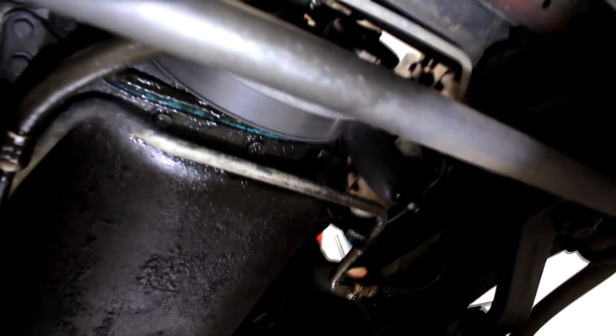Okay, so let's go underneath this thing, get my flashlight on here. Now look at how wet this is, guys. This is all soaked down here. It's definitely leaking some engine oil from under the crank seal. I can see it if I look behind this pulley down here. You can notice how it's definitely leaking a little from the top from the valve cover because there is grease and stuff up there, but down here it's very wet, and that's coming from the front crank seal. So I don't know, we might replace that when I do the belt. Just crank that crank pulley off, replace it.